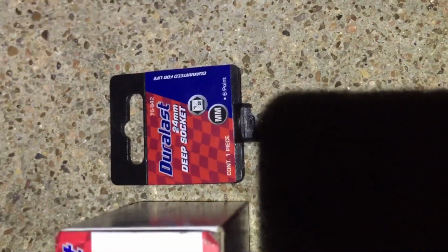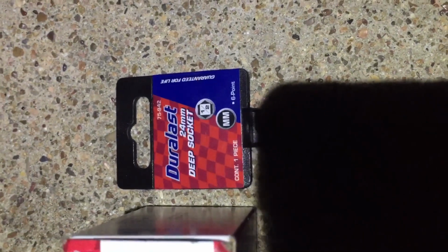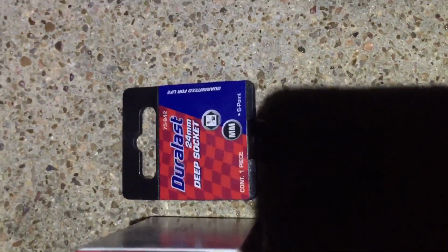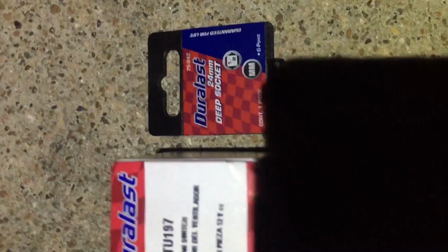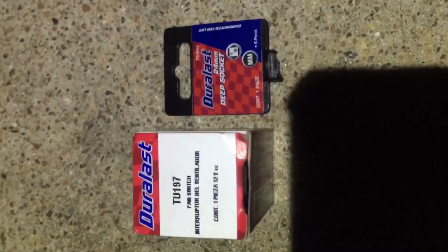Okay, this sensor is a TU197 from Autozone. I'll put a link in the description for this. Also, this baby is a 24mm socket. It's huge. The biggest I had was a 19mm, so I had to go to Autozone and buy a 24mm socket to fit it. It looks like I'm going to use a 1/2-inch drive with an extension to get to it, because it takes a little length to get past the frame piece that's down there. So I'm going to take that out and put the new one back in. Hopefully that setup is long enough to get across the frame piece and get to the temperature switch for the fans.